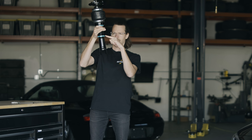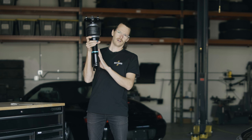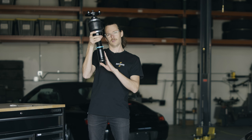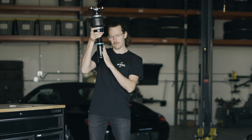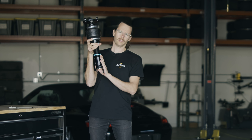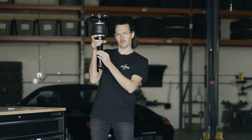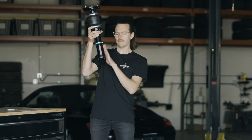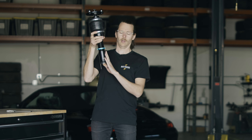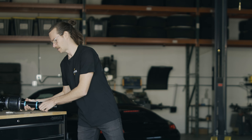This right here is a lock collar. The purpose of the lower lock collar is to prevent the lower mount from your shocks or struts from being able to move up and down on the threads. There are two ways a lock collar could cause an unwanted noise: the collar itself has a little play, or without it locking against the lower mount, the lower mount itself could move up and down.